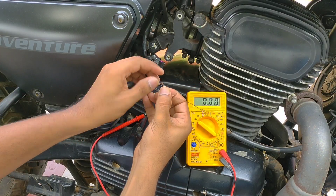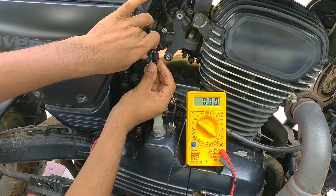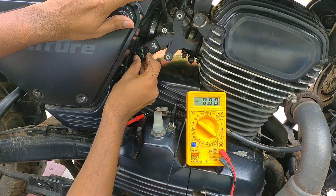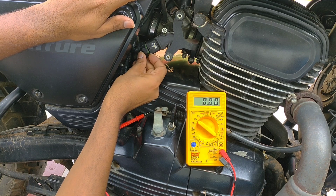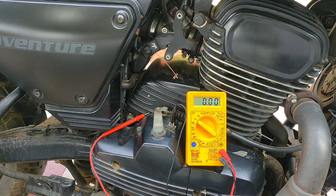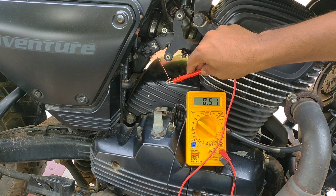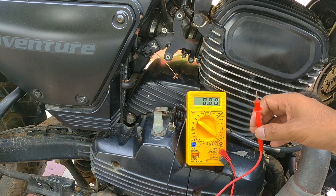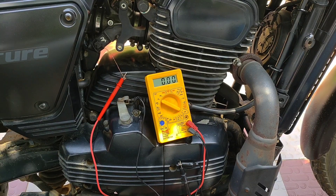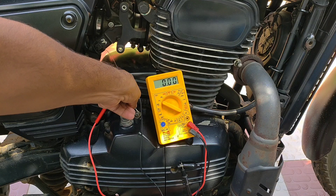We place the sensor cover holders back. Here is the procedure: strip the copper wire, remove the TPS port, insert the copper wire in pin 4, and insert the connector into the TPS sensor port. The positive of the multimeter should be connected to the copper wire. With the ignition on in idle state it should show 0.5 volts, and the negative should be connected to the chassis ground.